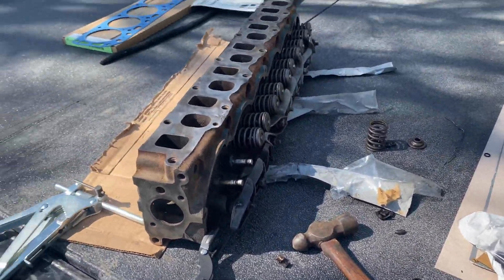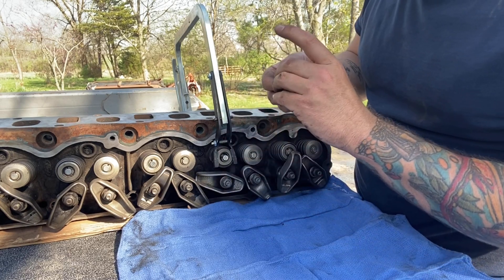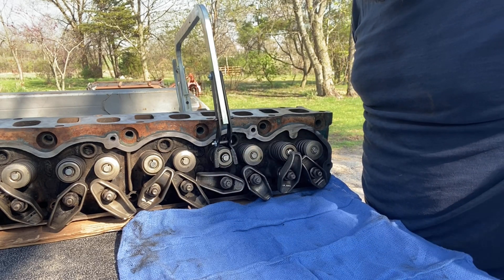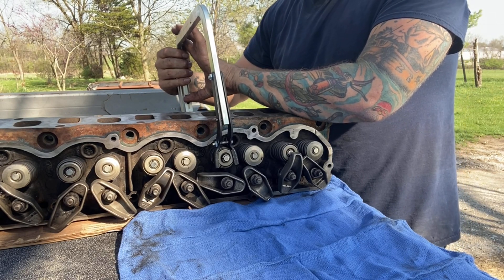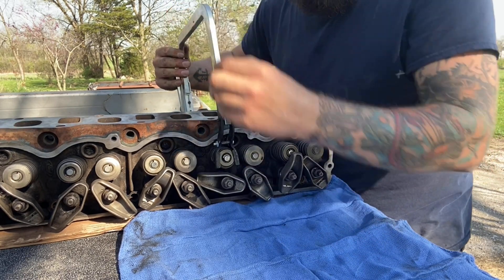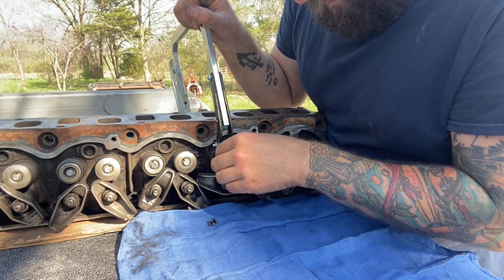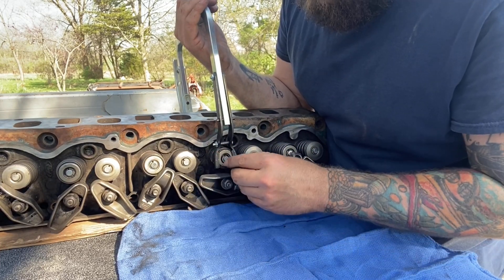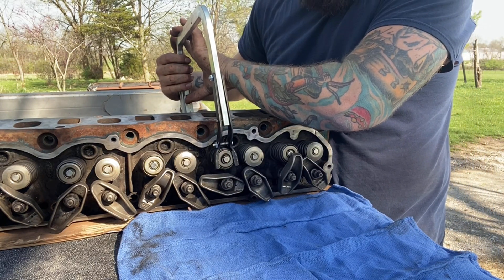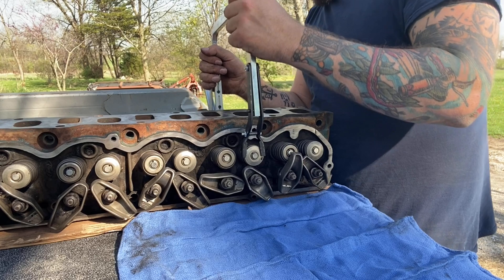Get this done. As you can see, I got that bottom one held in. We're gonna stick this one on top and see — that's kind of nice and good. So we'll grab the spring compressor, I'm gonna tighten down a little bit, release. The bottom one dropped out on me, so let's twist it to the side, put this one on top. It's a little tricky sometimes — it works, sometimes it doesn't. Right there — see that? Boom. We're gonna move on to the next valve.